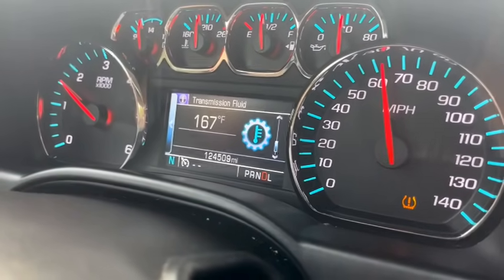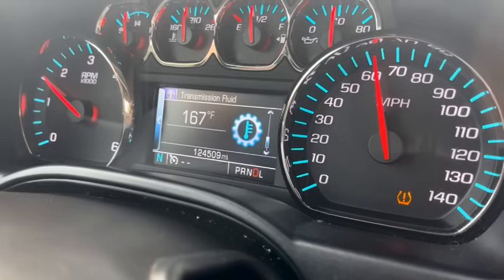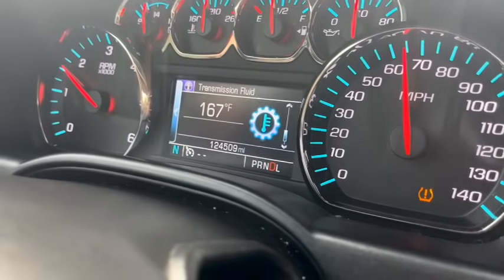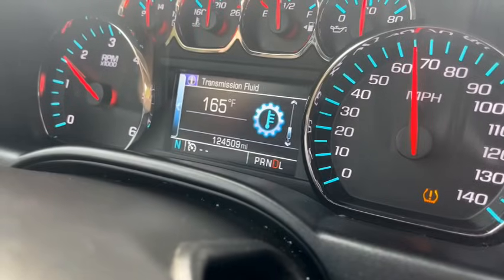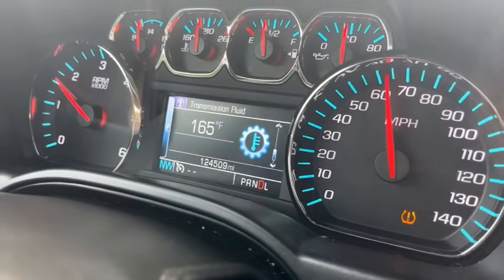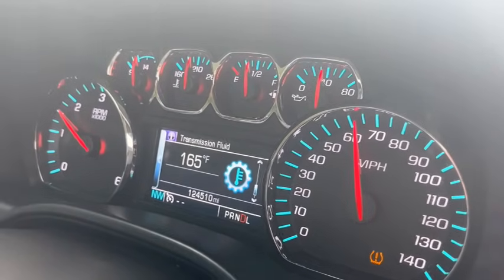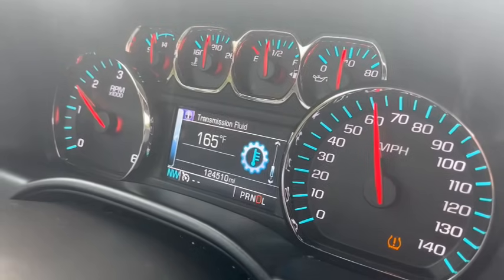Some of these get up to 195 — I may not have driven this truck enough earlier. Usually they get up to 195, so it's usually about a 30-degree shave off the temperature. We're at 165 — that's usually about where they run. I think I've made my point. That's what you want to see — a fluctuation between 165 and 170. We've shown you the benefits of putting the bypass delete in there and stopping that thermostat from working.